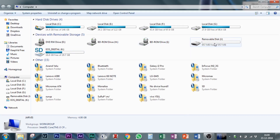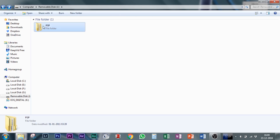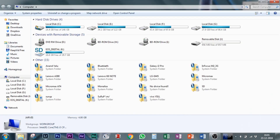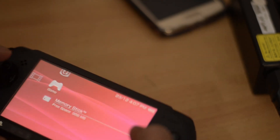I have a 1 GB memory card which is mostly empty. Open the PSP drive and create a new folder named GAME in all caps. I have already copied those two files, so I will paste the installer and launcher into that GAME folder. Once they are pasted, close the window and eject your PSP.